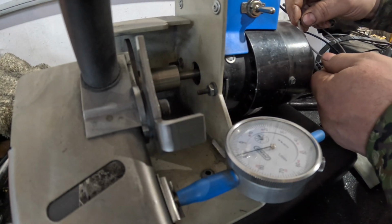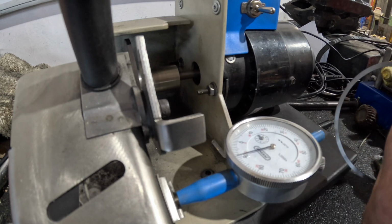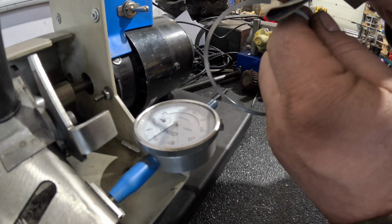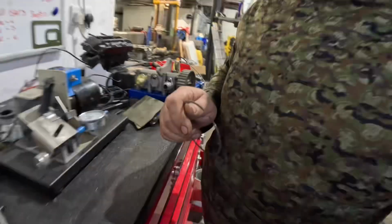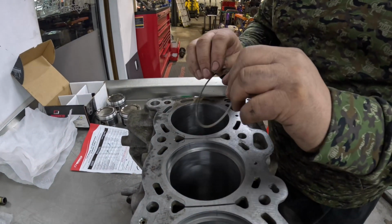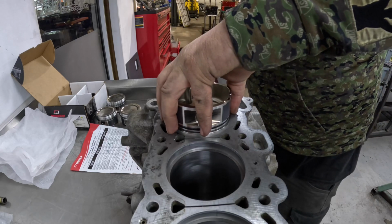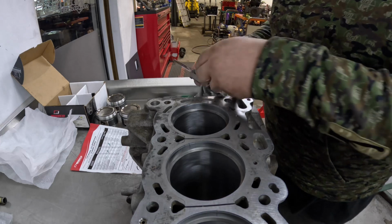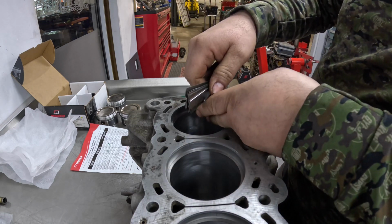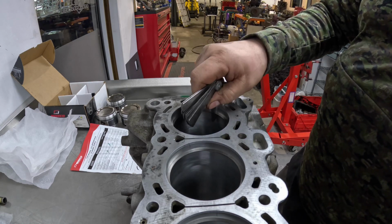And then a very slight deburr on the top and bottom. And then very gently, it's perfect. So we'll give it another measure. Hopefully it's right this time. Use the piston to get it at the right height, very carefully. And what we're after is 23 thou. That's 22 thou, so we need another thou out of that.